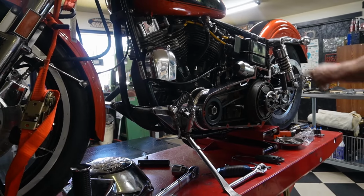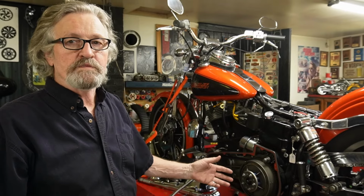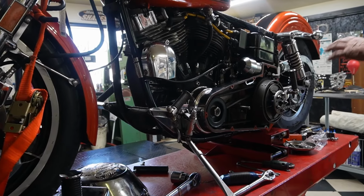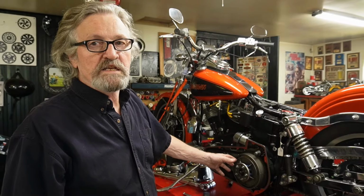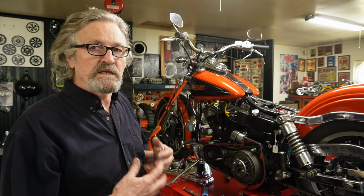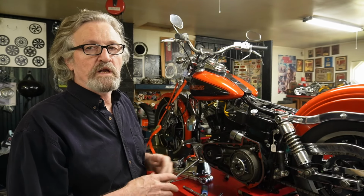So today I'm doing a little bit of work on my 81 here, and I've found out that I've got a bad Bendix on here. So I've got to take the Bendix out, and so we're going to have to remove some stuff. Also, when I had it running, I noticed there was a little bit of squeak in it. So just to be sure, I'm going to take the clutch basket out and check things there. I'm expecting it's got a big fix kit in it, and I'm just thinking that things might be dry from sitting there, but I'll know when I take it out.